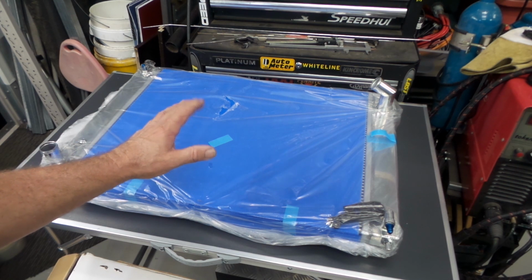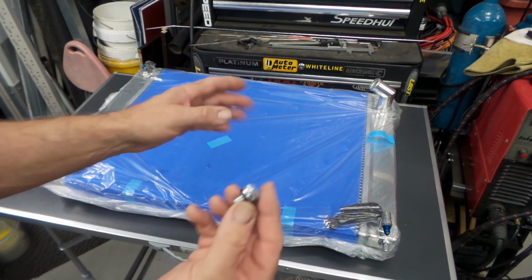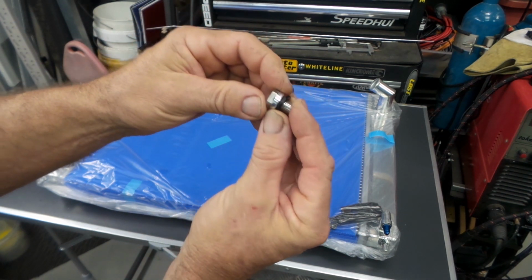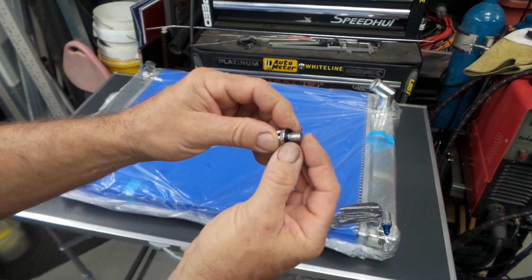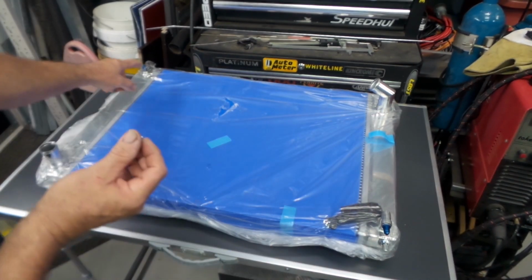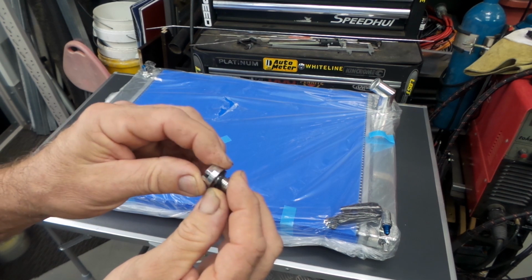The first thing that struck me was the quite kind of janky drain plug setup that they have on them. Basically, this is their drain plug arrangement here. This is one of their drain plug bolts. It's just a bolt which is made of aluminium, mind you, with a rubber seal on it. They're M10 by 1.25 and they just thread in. One thread's in down here, the other thread's in over here, and mate, in my opinion, they're just the most crap thing ever.